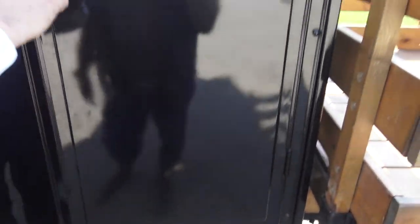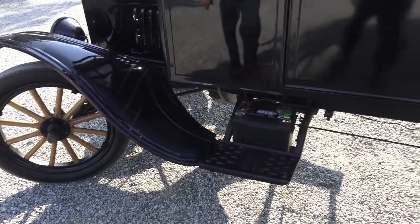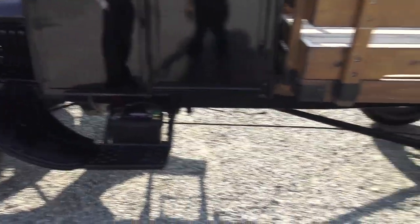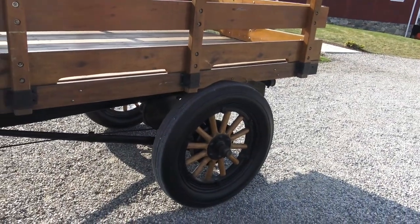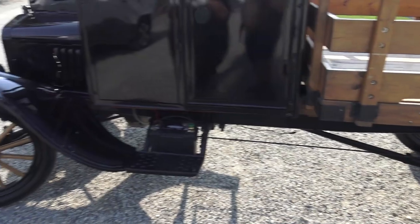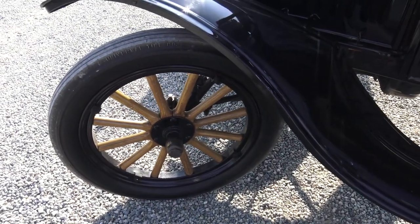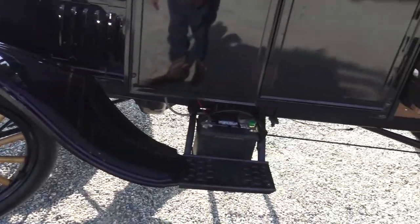Ford only sold you the chassis in the late teens and early 20s. This happens to be a cab built by a company called Field Durable Bodies in Owosso, Michigan — up between Lansing and Flint. So that's a 1-ton, but they didn't have duals on their 1-ton back then. They're the same wooden spokes but heavier duty than a standard Model T. Those spokes are very expensive — it's hard to find someone to make wheels for them. My 1914, I just had them re-spoked by an Amish group out of Indiana. You see these here? It's a detachable rim — so you actually take the wheel and the tire off and swap it out if you get a flat tire.